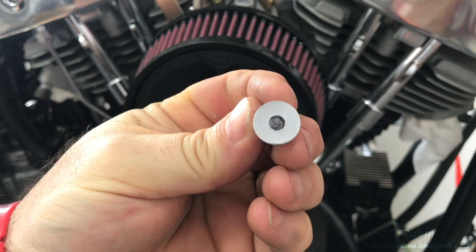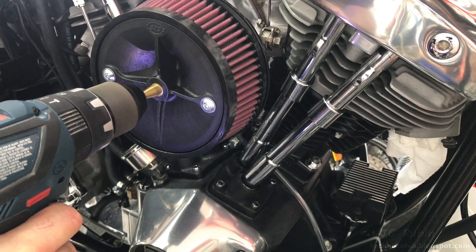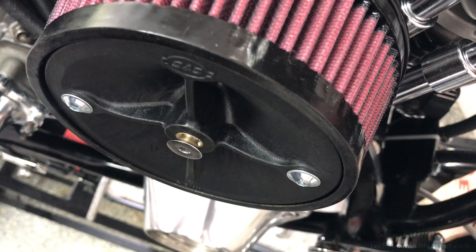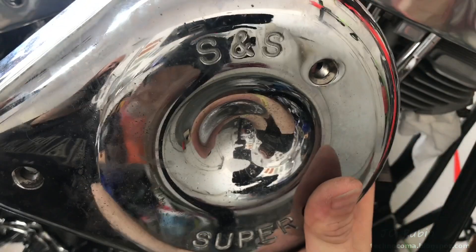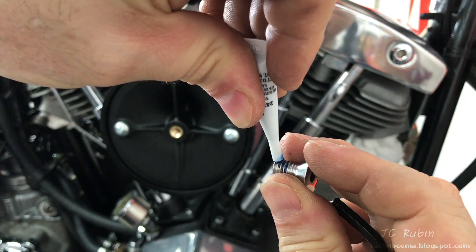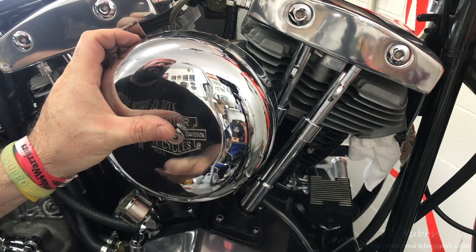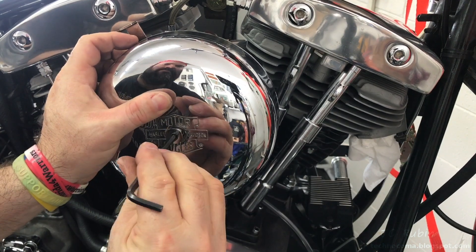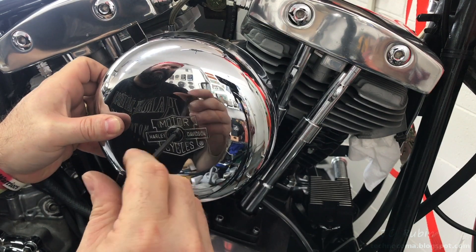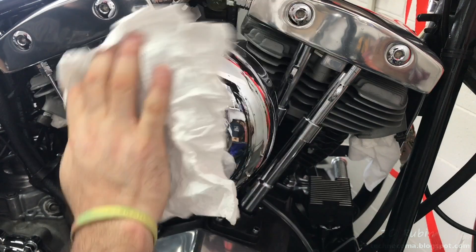Here's a special bolt picked up at Ace for the exact bevel of my air filter. I removed just enough threads so it'll fit perfectly. This also required countersinking a bevel, so I used my smallest bevel tool to do that. Installing the screw without a cover, the bevel of the screw sits a couple of millimeters deeper than the face of the brass. All this means I don't have to use the S&S teardrop air filter cover that everybody has — I can put an original cover back on. A couple drops of blue Loctite on that screw, and now we can put an original Harley round air filter cover back on a shorty E-carburetor. Tying it down with this hex bolt, making sure it's straight with the logo. Everything's level, tighten it a couple of foot-pounds and get all the fingerprints off.